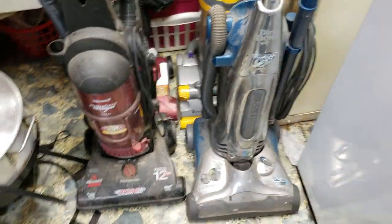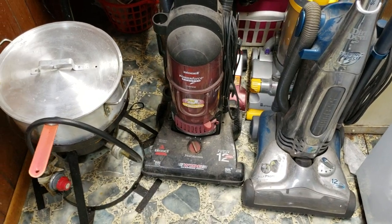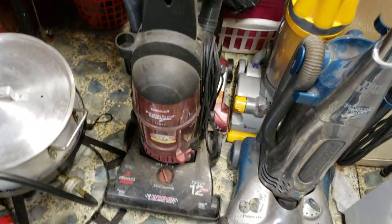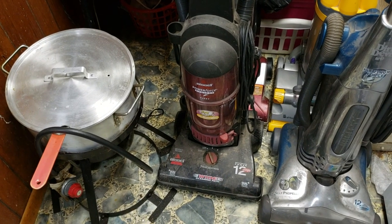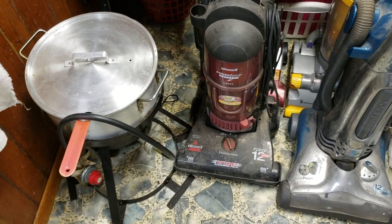Now that we go into the house, we can see the other aspect of my collection, starting with the laundry room. There's a Shark steam mop here that I'm trying to sell, haven't sold it yet. Two machines that were out on the back porch are now in here: the Dirt Devil Platinum Force and the Bissell Power Force Bagless Turbo. Both do work, just in need of a cleaning. The Bissell has a little motor problem where it sounds more roarish than usual, perhaps due to dust going through the motor. A good clean, oiling, and maybe a polishing of the commutator should hopefully remedy that.